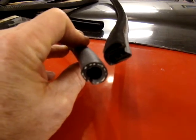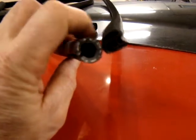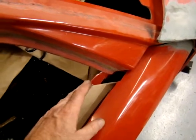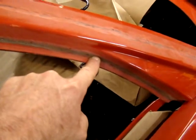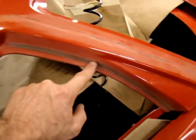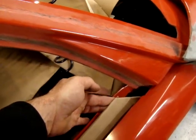Once you use the tubing, you don't have to cut your felt seals up as long as the height where it meets the window is about the same once it's attached to the flange. I knew that was going to hit, so I took a three-inch cutting wheel and cut in the radius of the flange all the way up to that point. I originally stopped there, but the radius wasn't a nice radius through the whole area, so I extended the cut all the way to the top. That way this entire piece was basically floating and I could bend it to the curvature of the window exactly the way I needed it.